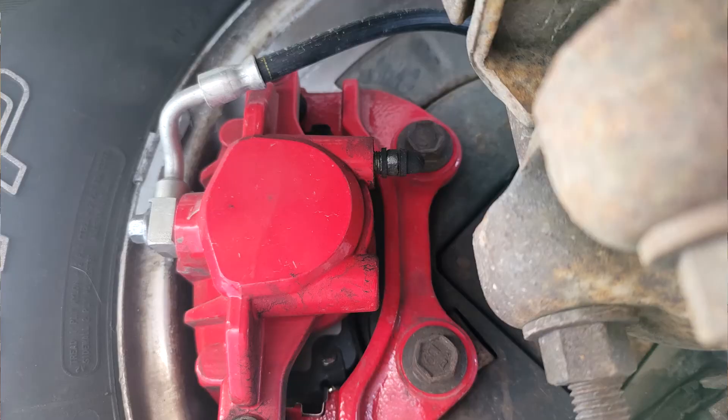Okay, we're back for the final update. I built one of those pressurized power bleed systems — it works beautifully. Still had no brakes, still couldn't figure it out. Did a little more research. I put the calipers on the wrong side, which put the bleeder valve on the bottom — and that's supposed to be on the top. On the rears it's a little more difficult to determine. The bleeder valve is practically in the center of the caliper on my truck, but if you look there's an upper and a lower part — and it was in the lower part of course. So I had to reverse them to the other side.